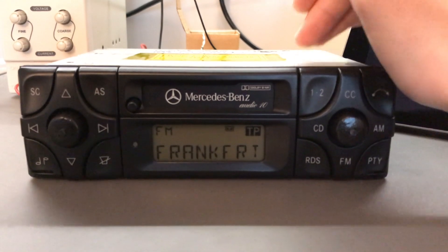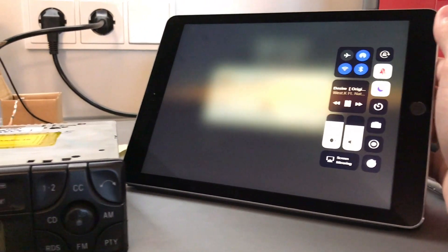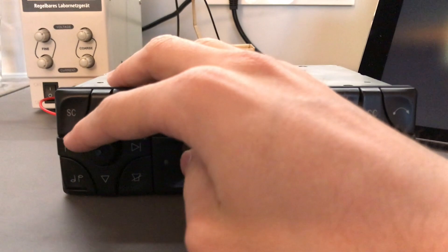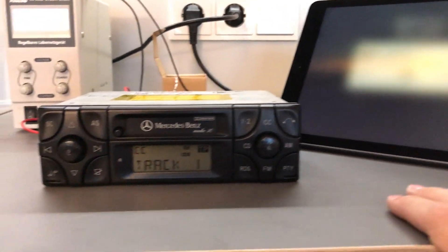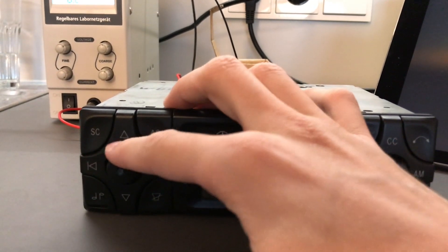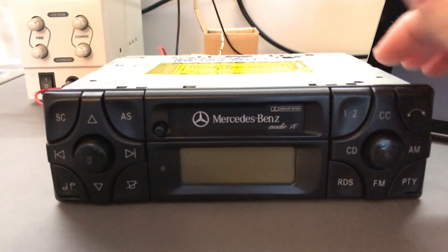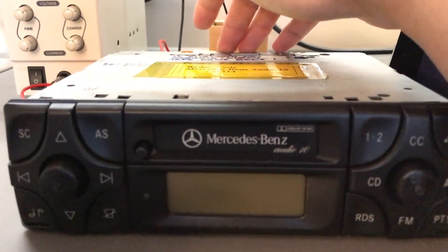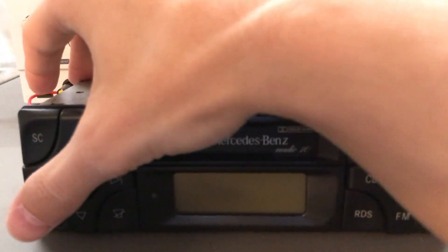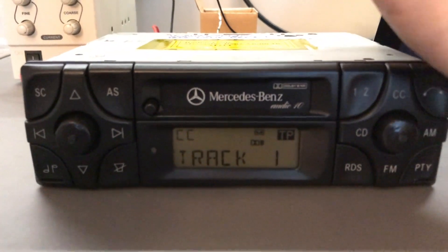So it's best to just have it on when you want it to be playing. And obviously you could just hit play on the phone, then hit the cassette and it should steal the audio. It does actually work quite nicely — I'm quite proud of this. The reason why you'd have it go through the cassette and not directly into the inputs of the power amplifier is to have access to the volume here, because it's really cumbersome to have to go to the phone. I've actually tried that and it's really not doable.